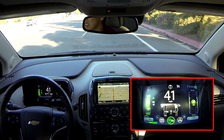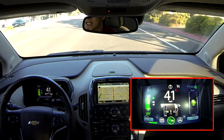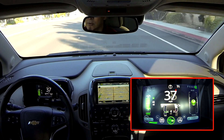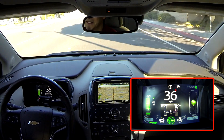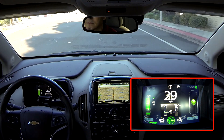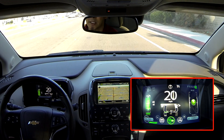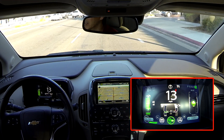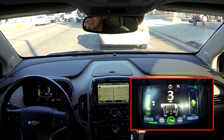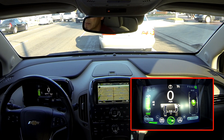Now, having said that, if you're about to get on the freeway on-ramp, then 23 kilowatts is probably not enough to get you up to speed quickly enough so that you don't get run over by someone behind you. I typically can go up to 35–38 kilowatts, and I consider that a general acceleration to freeway speeds. But if you're going out on the freeway, you're really not getting into hypermiling at that point.